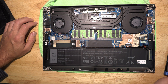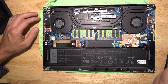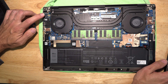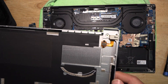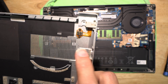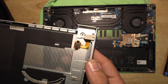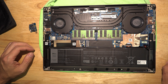Got that disconnected. The daughter board for the card reader is right over here, and you can see that's where it's going to go. As for the audio jack — you can kind of see the hole for it right here. There are some contacts here, and interestingly the audio jack is actually on the bottom cover. There are little pogo pin-style connectors, so when that bottom plate is screwed onto the chassis it makes the connection. That's where the audio jack is in relation to all of this.